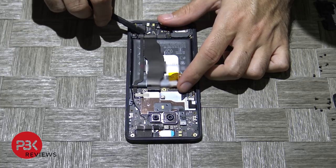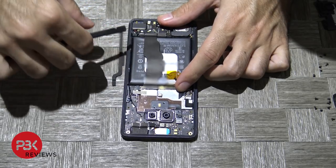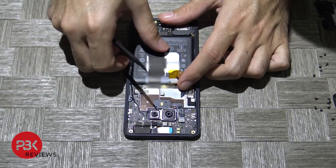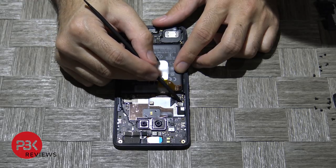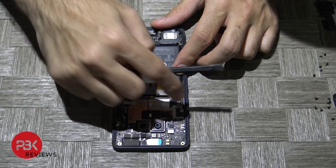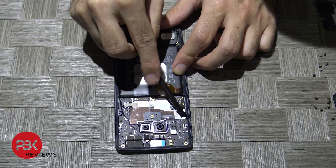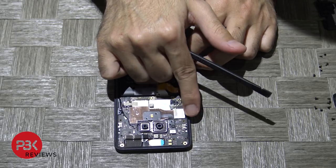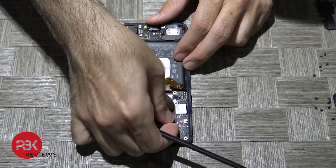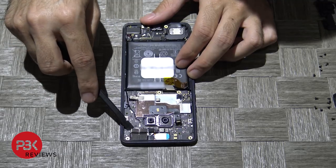These two you can disconnect from the bottom as well. Next, there's a cover over here covering the connector for your haptic feedback buttons. Go ahead and lift up that cover — it's like a shield. Then go ahead and disconnect the cable for your haptic feedback buttons. Now if you need to replace the flash over here, the connector is over here — disconnect it off the board and pop it up. And your two cables over here for your front-facing cameras right here — disconnect those.